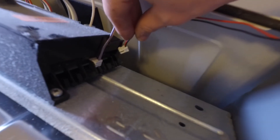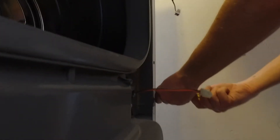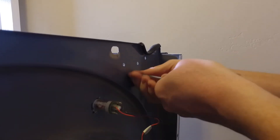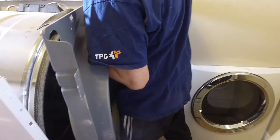We're not done with the plugs yet. Back at the dryer, there's another plug that goes to a little light in the front here. You'll want to take that off because we're going to take this panel off as well, starting with the screws on the bottom — there are two along the bottom here. And there are two other screws along the top here that will need to come out as well in order for us to get that panel off. And once those are gone, that panel will come off easily.